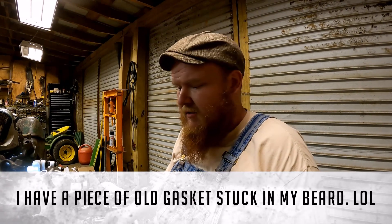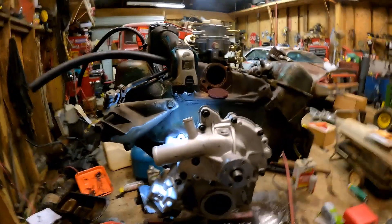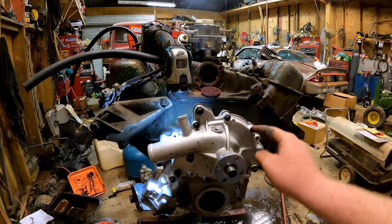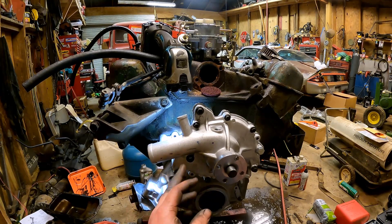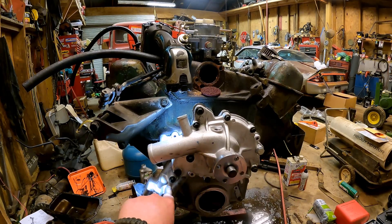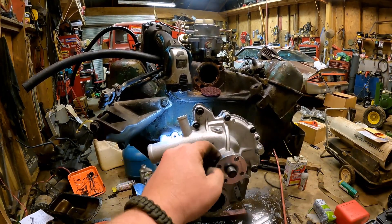Alright, so we're back. I waited longer than I intended, but it's for good reason. Got everything on here — got the new water pump installed right here, and got everything torqued to proper spec. For the water pump, including the bolt that holds it on, I think it's six to eight pounds, so I did them all to eight. These are all torqued. The timing cover — I think it's 25 to 33 — I did it to 30. So these are all torqued. This whole assembly is attached and torqued to a proper rating.